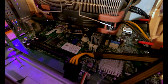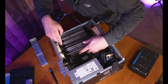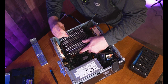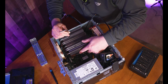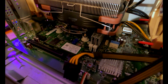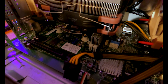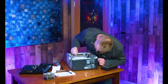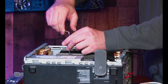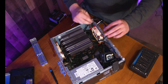Get this cooler in there — it's super hard to see, but you can confirm the bottom screw is lined up and then check the top screw. Make sure the heatsink looks square before dropping it. As long as the top screw starts to thread, you're lined up. You have to go through the heatsink and catch the Phillips screw at the bottom with your screwdriver. These screws bottom out all the way — you want them to go until they stop; there's a spring that sets the tension. Once done, tuck your other wire underneath the fan so it doesn't block cooling.